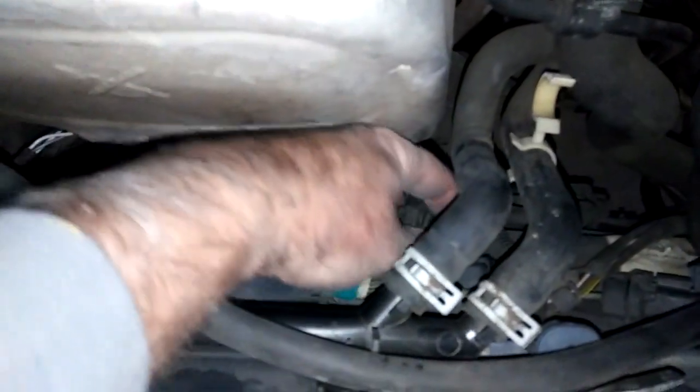This is a shortcut for someone who is near-professional. Walk it from this hole in your fan, put it inside, walk it over with your fingers, pull out and use your other hand — you have to be ambidextrous to do this. I used this screwdriver to pry the fan shroud out, reached my fingers in, twisted it all around, got it into place, and snapped it in.